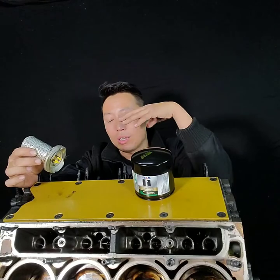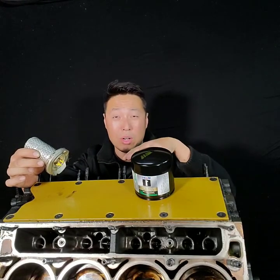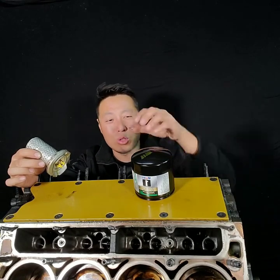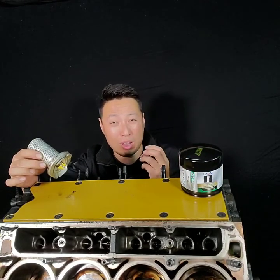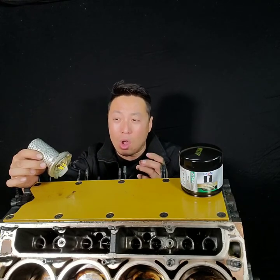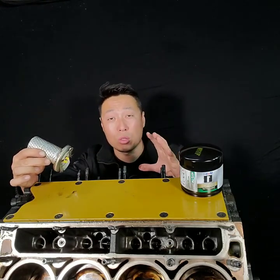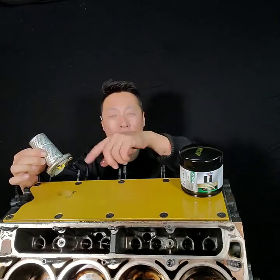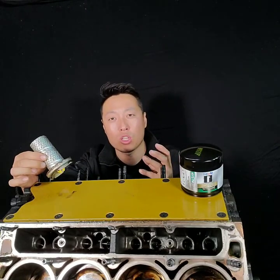My concern is: yes, I did run a little low on oil, but it was still 30 to 40 psi — not extraordinarily low to where the engine should have a lot of bearing and journal contact. It almost feels like maybe the bypass valve was open the whole time just because I'm on my car so hard, and it's circulating all the bearing material. Whatever falls off gets circulated back into the journals and just makes the problem worse and worse.